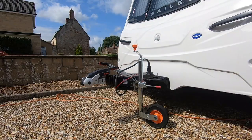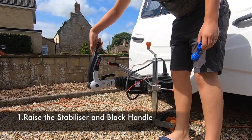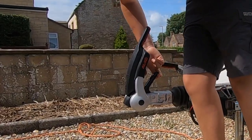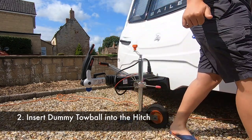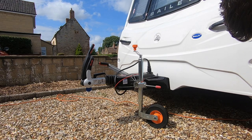So we're going to fit the Nemesis Ultra hitch lock. The first job is to lift the stabiliser handle up and the black handle up. Lift these two up and then put the blue safety ball in. That means that the caravan cannot be hitched up, put onto a smaller dummy tow ball and taken away — instead, the hitch is totally blocked and you cannot get anything in.